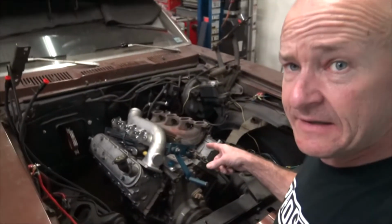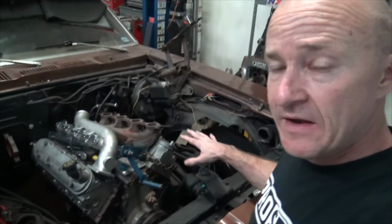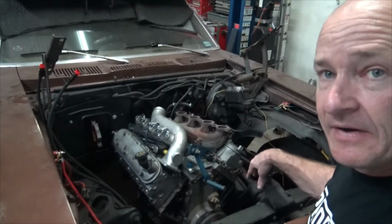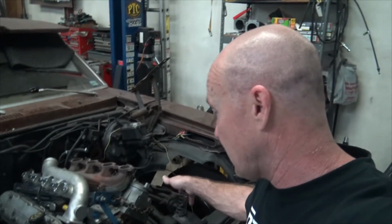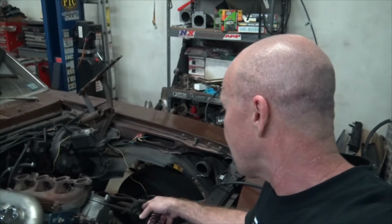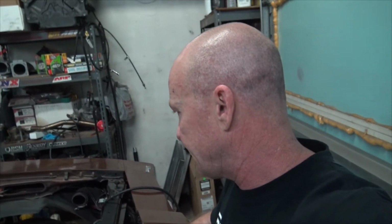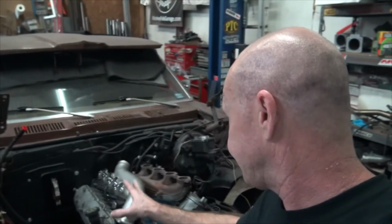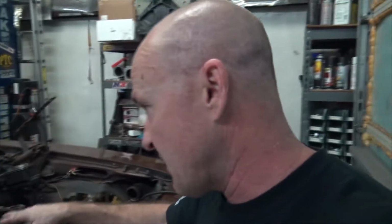So we need to largely sort all this stuff. I'm waiting on the radiator stuff still. Once we get it mounted, then we can get the water pump on here, the brackets, the air conditioner bracket, the alternator, and the power steering pump brackets back on, and then we can try to figure out what we're going to do about hanging our turbo and running the exhaust through. Once all that's done, we can put the fender liner in. We'll probably have the fender liner in and out a few times, but we'll have it in here so we can see what we've got to deal with. And yeah, we've got to get all that stuff done before we can finish off the air conditioner stuff.